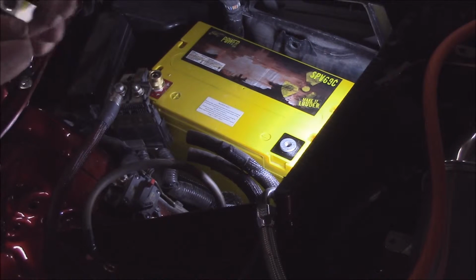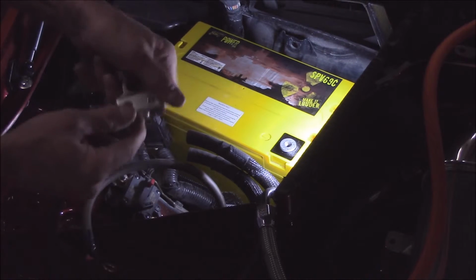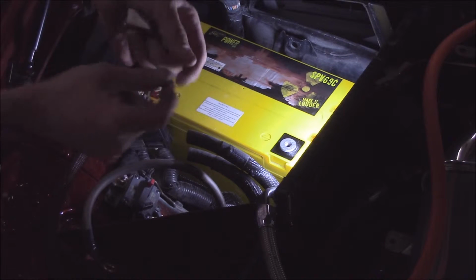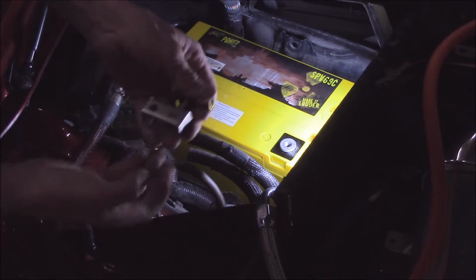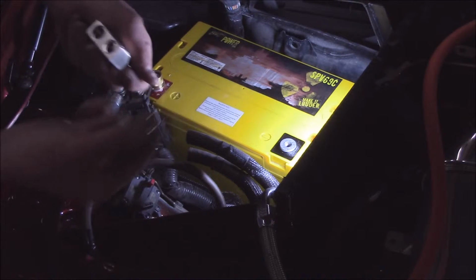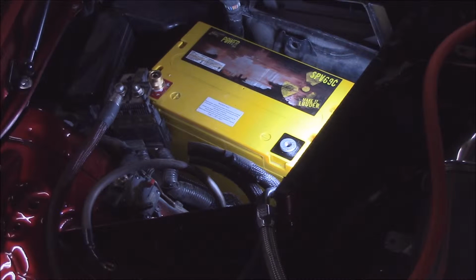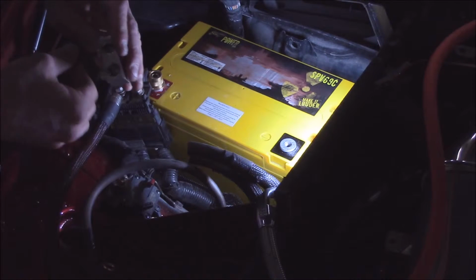Now, one of the things when you're doing this, because we're doing AWG connections here, I'm going to bring this up out of the light. There is an internal sleeve in this connector. You need to remove this. So that requires you to take the leading nut out and then pull out these barrels. We will not need these because we are using the AWG connector. Alright, so let me get this other one pulled out real quick.